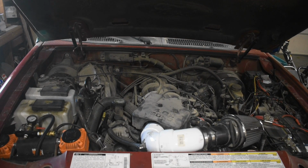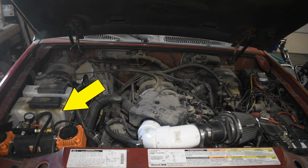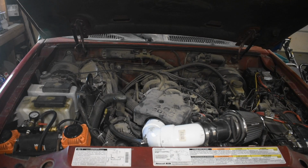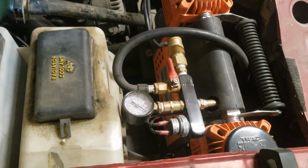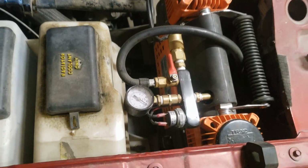Any attempt would be clunky. What we need to do is get the intake back over by the fender. This will give the engine colder air to intake and gives better access for snorkel stuff in the future. I think the best bet is over by the air compressor, where the original location of the filter housing was. There's roughly a 3-inch gap between the air compressor and the factory coolant overflow tank.